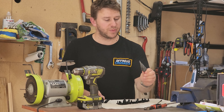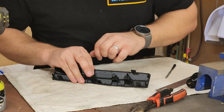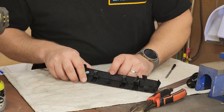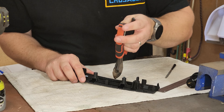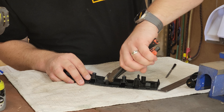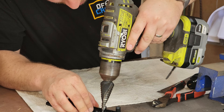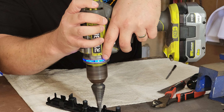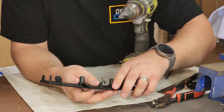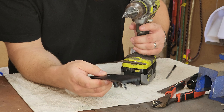So we're going to drill a hole through this. The best way to do it is with a step drill — here I've got a step drill that goes all the way out to I think it's 30mm. You can see there's a bit of a ridge there to help with the rigidity of this, and that's obviously going to get in the way of our drilling, so I'm just going to remove a snippet out of that using my side cutters. I'm going to drill my hole through here now with my centre mark. I do like to try and do all my measurements and my first drill from the back of the piece of plastic. It just helps to locate it all and that way you don't end up scuffing the front face with your measurements. Then from there I can flip the piece of plastic over and drill from there.